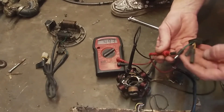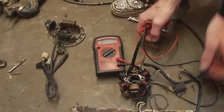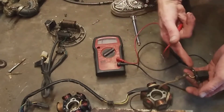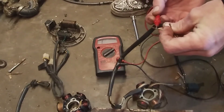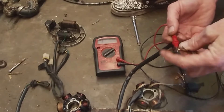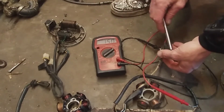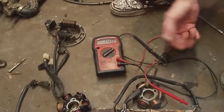Let's check the trigger coil and see how many ohms it's putting out. It's going to be your blue and white wire typically. We're going to have to ground it to the actual trigger itself — on this one it's a blue and yellow wire. Typically I think these are usually around 150 ohms. So 149 ohms — that's typical for your trigger coil. You could test these by waving a little refrigerator magnet by the sensor. Wave any metal by it and you can tell it works. Typically 150 ohms means your system is good.